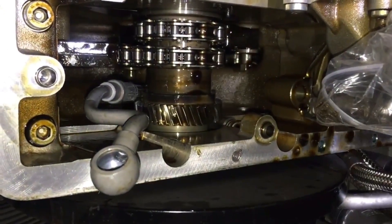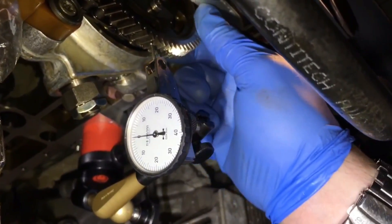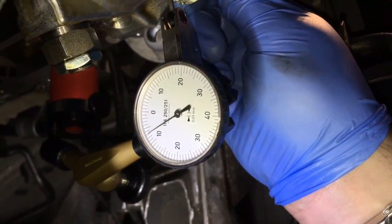Now that's in we can get that roughly located at the top where it comes out of the engine block to the distribution piece. The vanos high pressure pump is located and then finally the sealing rings and the banjo bolt can go through and connect that new high pressure internal pipe. The oil high pressure pipe is now in the correct position. We've got the vanos pump refitted with the chain correct and the tensioner in position. Now we've got the genuine BMW special tool set up to check and set the backlash between the vanos high pressure pump gear wheel and the crankshaft driven wheel. It's got to be between 0.06mm and 0.08mm, and we've set it to 0.07mm which is absolutely perfect in the middle.